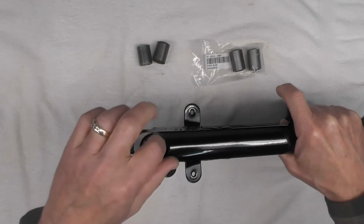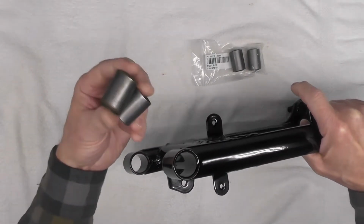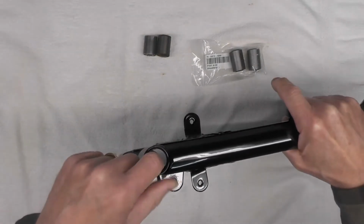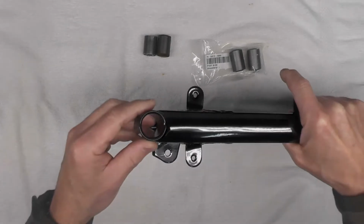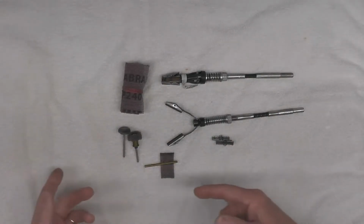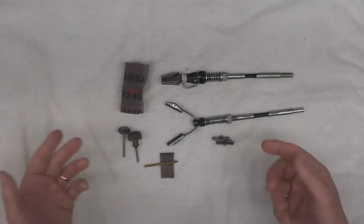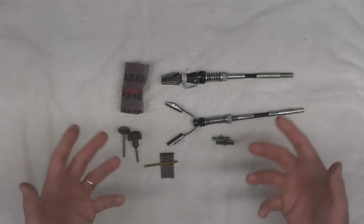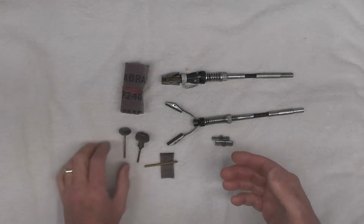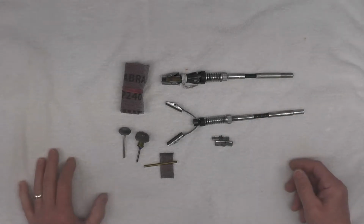We're going to have to remove that powder coating on the inside because this is a tight, actually almost an interference fit, and this powder coating is just simply going to get in the way. Let's talk about the techniques available to remove that powder coating. You can't use heat to burn it out because you'd destroy the powder coating on the outside of the frame, so we have to come up with an alternative, and that typically involves some kind of abrasive, a sanding or a grinding type operation.